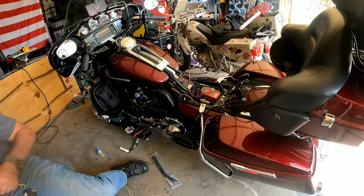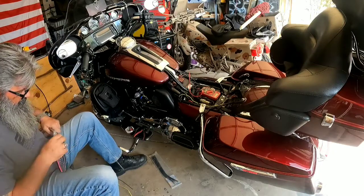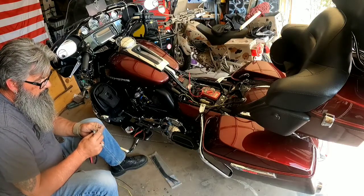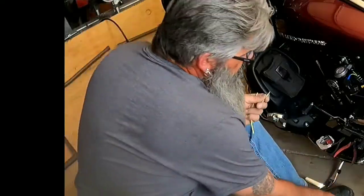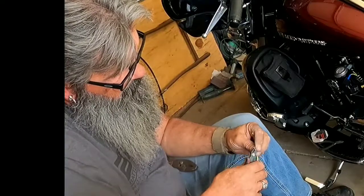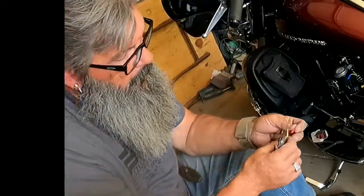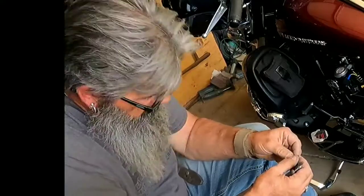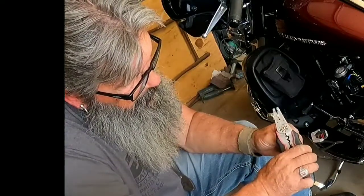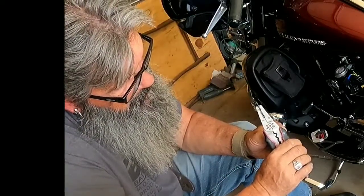Sometimes you need a little help. So the insulation on these aircraft wires are pretty tough. There we go. Use the diameter of this wire just a hair to go on the smaller connector because that's all I've got. Needing is a male spade connector that goes up to my factory horn wire. This would normally be the connector that's on the relay. Crimped on nice and tight.